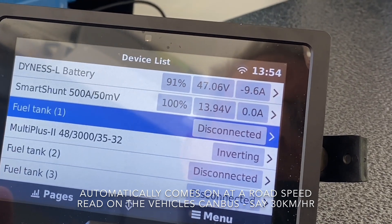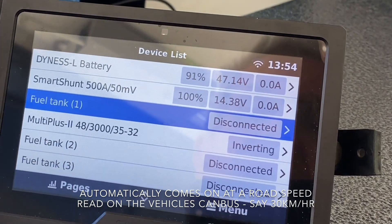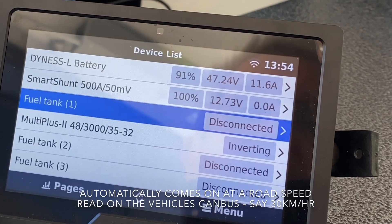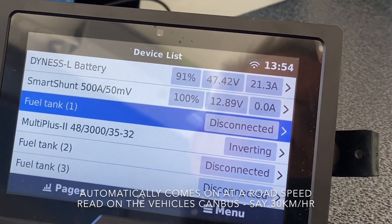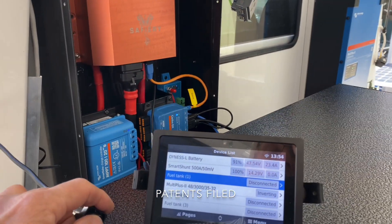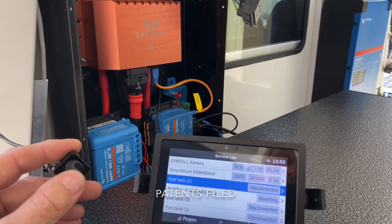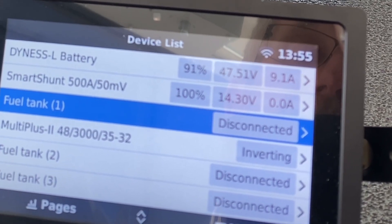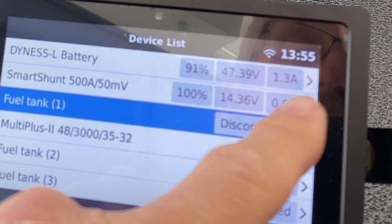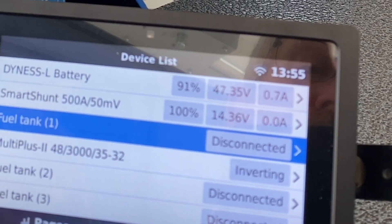That's probably the preferred way to do it — reading from the CAN bus and setting a particular speed, say 30 kilometres an hour, so the DC-to-DC will not come on at full load until you're over that speed, unless you've got the manual switch turned on. With the switch on, it'll pull full power to charge up the 48-volt batteries. This is actually quite a breakthrough — not just for Australia but globally. Total bidirectional: flick the switch and at 14.5 volts the current reverses and puts a slight charge back into the battery.